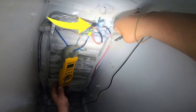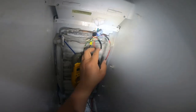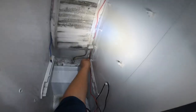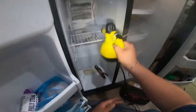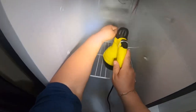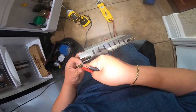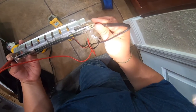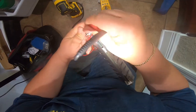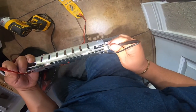Now we're going to find out if the heat element is fine. The thermistor checked kind of okay and the defrost thermostat checked okay. Now we check the heater. I still suggest replacing all three. Go ahead and defrost all the ice buildup — I have a steamer, but if you don't own one just let it defrost for a couple of hours. Don't use a hair dryer because you can damage the refrigerator cabinet. I'm testing the heat element by putting my leads on the terminals with the tester set to continuity, and I'm not getting any continuity at all. So the heat element is the problem in this case.